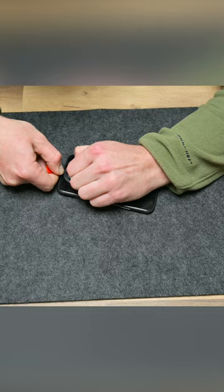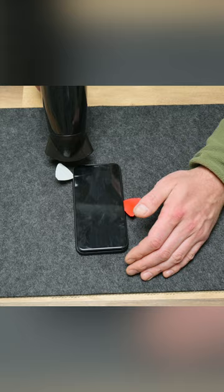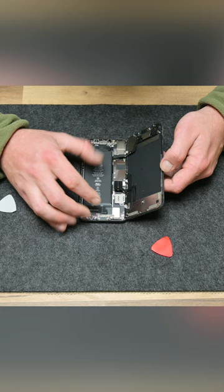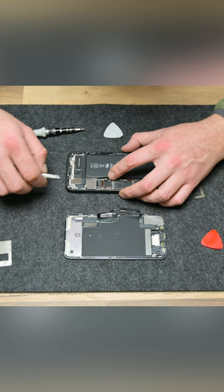This problem may come from a few things — something wrong with the hardware or some bug in the software. Carefully, I removed the iPhone screen, disconnected the whole display, and disconnected the battery. I drained the power from the board by pressing the power button a few times, and I reconnected everything again. And now the touch is working just fine.